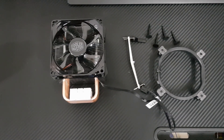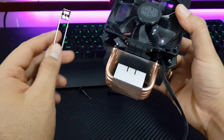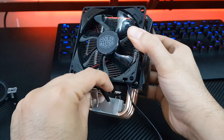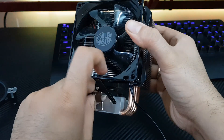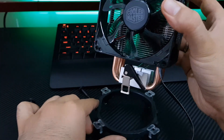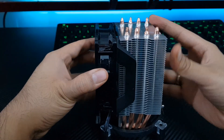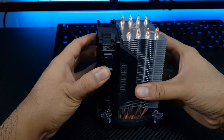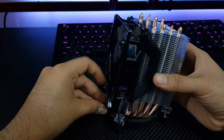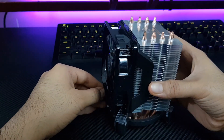Now to install it, let me show you how to do it outside of the case as my camera takes poor footage inside the cramped CPU case. There are slots where the provided latch is attached and then you put the whole assembly on the bracket. First, you mount the bracket on your motherboard — there are four holes around the CPU socket where you insert the bracket using the pins, with no screws to deal with. Once the bracket is secured, take the fan and latch assembly and lock it onto the notch. It is as simple as that.